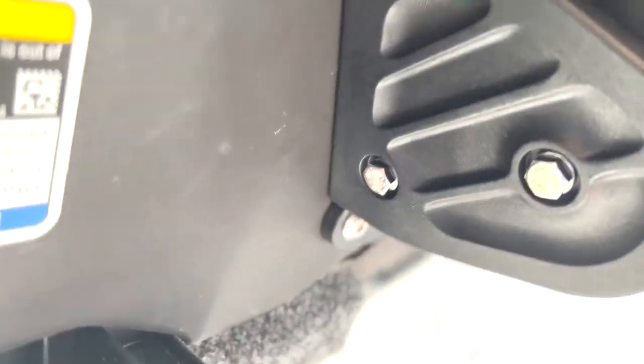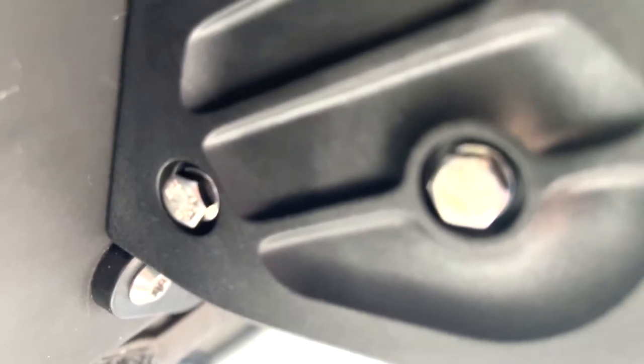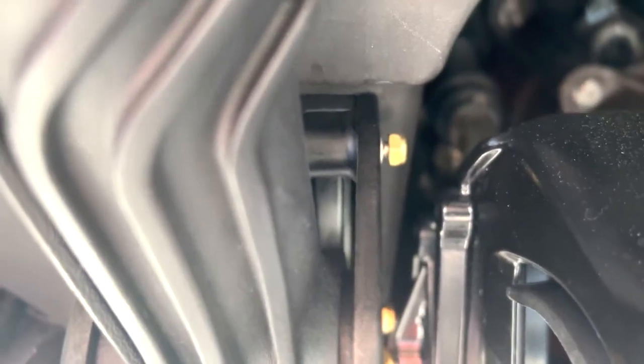The bolts themselves, you want to put them this way and the nut on the inside. That way, when you're reaching or working in here, you're not getting caught up on that. Also, it does match the factory one, which is this one here, that has the nut on that side. It's a 10 millimeter nut, so I'm going to get ready to fasten it down. Doesn't look like I can get a ratchet in there, so an open wrench will have to do.